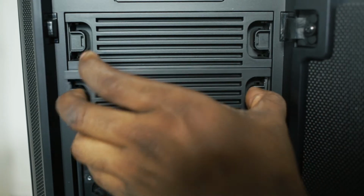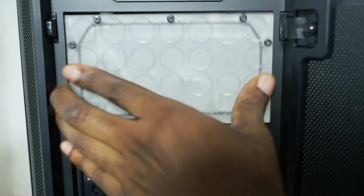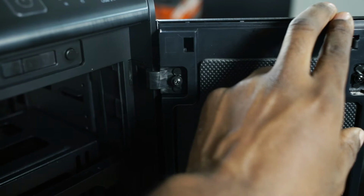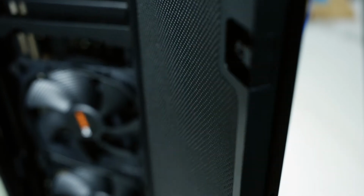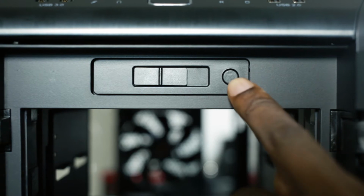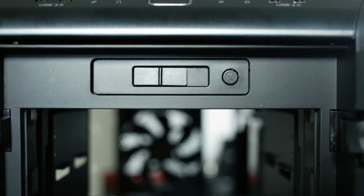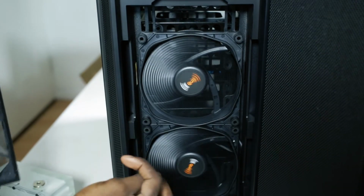On the front of the case there's a brushed aluminium door which is very well made. When you open the door there are either 2 disk drives if you're old school, or a space for a reservoir if you're water cooling, or another option is to add a 120mm fan or 140mm fan; the bracket is included. Also on the front of the door you will find another thicker layer of sound dampening, which is around 4mm thick, and a front sliding switch which is also used to control the fans. Next to the switch you will find a button which is used to cycle through the different LED light options or turn them off completely. Below these button features you will also find two 140mm Silent Wings fans.